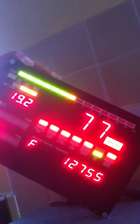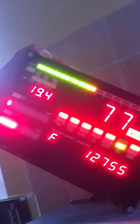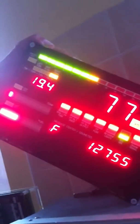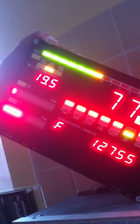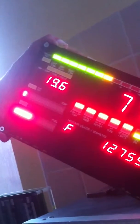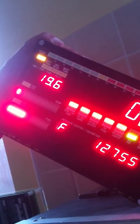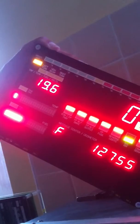We also have, in normal running mode, a number of telltale indicators. For example, these 3 indicators here are telltales for the left turn signal, the right turn signal, and the high beam lights. We have diagnostic indicators, this one for the speedo, which if the speed signal is lost, then this comes on to indicate there's no speed signal, or you're just doing 0 miles per hour.